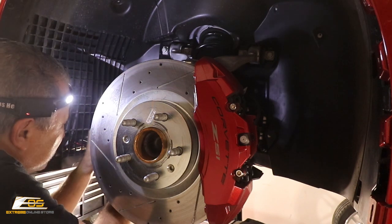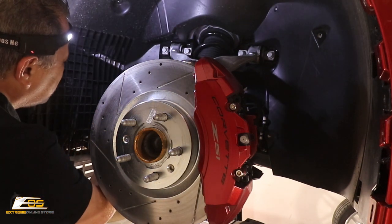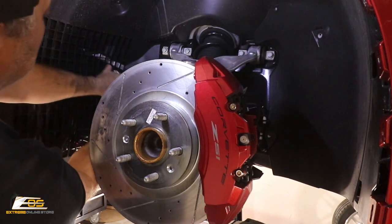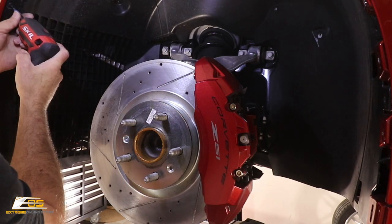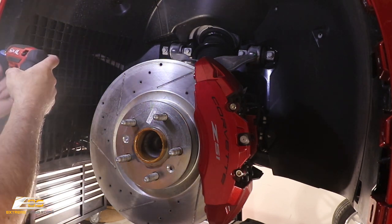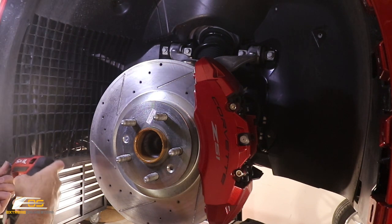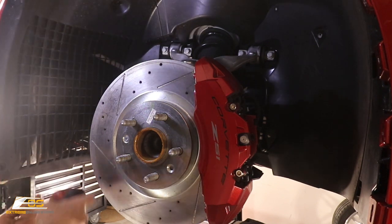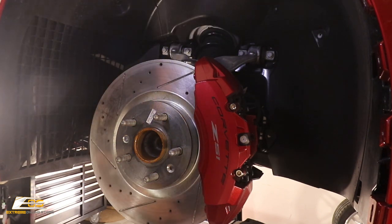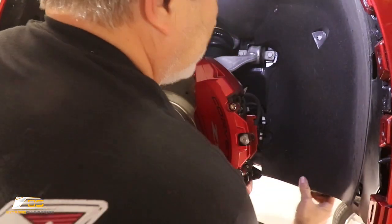All right, so then we've got a screw here at the bottom of this vent here. So these screws are hiding in plain sight, guys, so it's not really a big deal. You'll see them. Just be on the lookout for them. Okay, and then we've got our four screws here on this edge. All right, now I just gotta set my screws down. There we go. And now we should be able to go ahead and pull our wheel liner out if I haven't forgot one again.